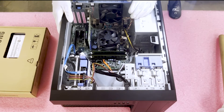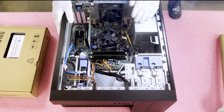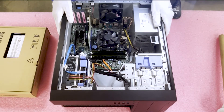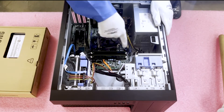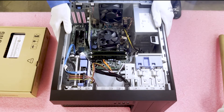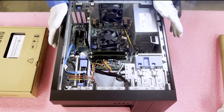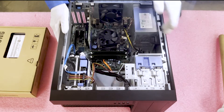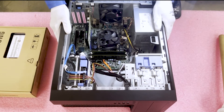As far as the RAM is concerned, there are four DIMM slots and two memory channels. The memory channels are color coded — white is the start of the memory channel, black is the second slot. As it's configured right now, the two DIMMs are in the two white slots, which is the proper way to configure it. If you only have two DIMMs and aren't maxing out with four, you'd put them in DIMM slot one and DIMM slot two — they're labeled on the motherboard. The reason for this is to have proper balance across your load; you get more performance by putting them in different channels rather than the same channel.